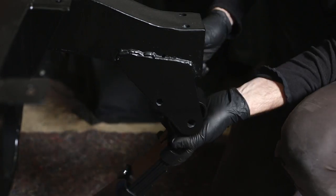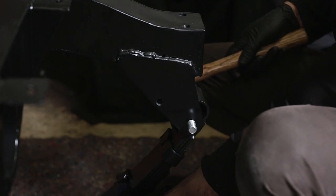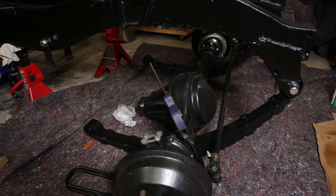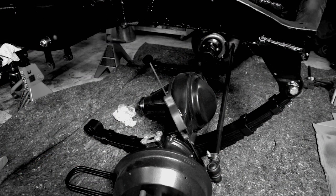And the front springs have been fixed up so that they don't hit the chassis anymore. Perfect. As far as fitting the front axle goes, it's the same as the rear. But I hit another problem. These U-bolts are not quite long enough. Wonder if these new springs are marginally thicker. I'm going to hit pause here because there's some explaining to do.